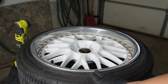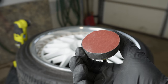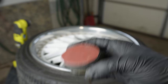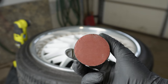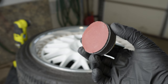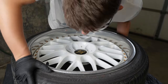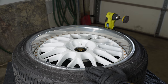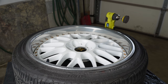Now that we've smoothed out the surface much more, we can move on to the sandpaper. The sanding pads are 400 grit that we're going to start with, and we're going to make sure it's nice and even and smooth across. Once it is, we're going to move up to higher and higher grits to get to the finish that we want. I wouldn't recommend starting with anything lower than 400. Upon further inspection, it seems it's not smoothed out enough, so we're going to go back to the filing using one of the grinding discs. Once we have it more evened out, we'll jump back to the sandpaper.